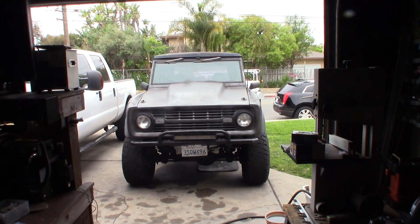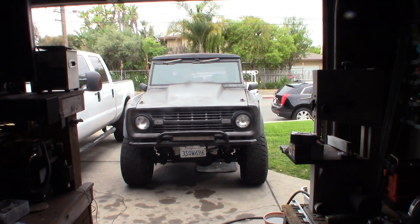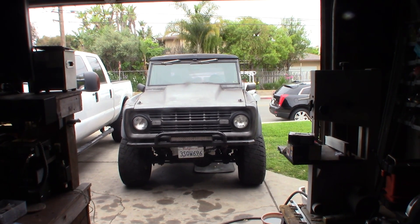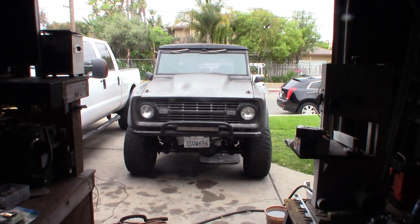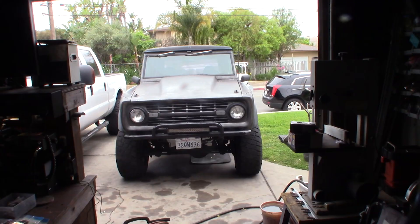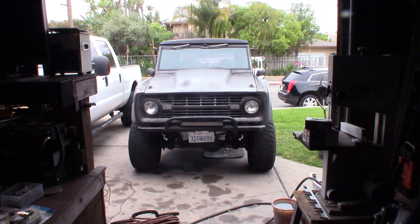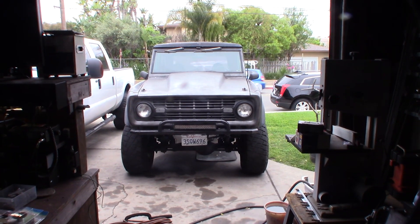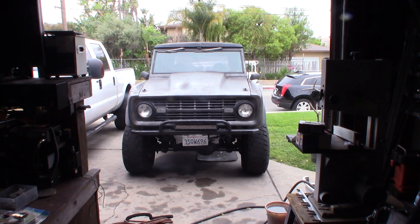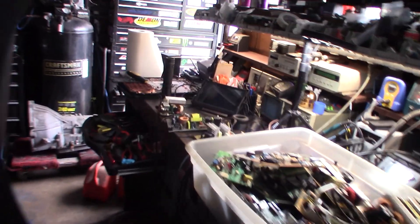The struggle continues — I'm still having an issue with interference. The car is running with my new Quad Six Pro, and as soon as you turn the car on it starts getting that crazy noise. My noise floor goes way up and I can't hear anything. What's funny though, it's getting better. All the stuff I've been doing with the Bandit — noise filters, adding capacitors and ferrites everywhere — is making it better, but it still has some serious issues.